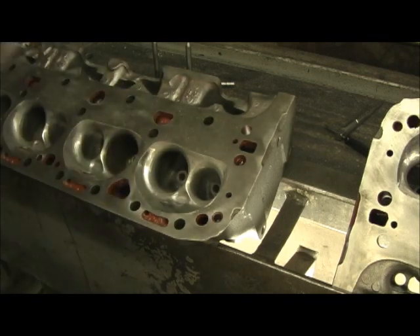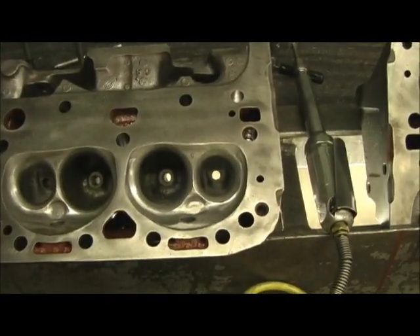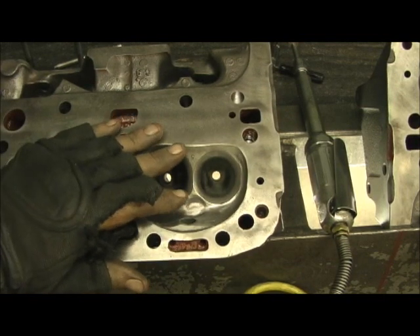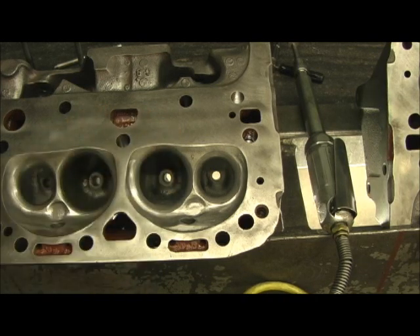The main reason that I do this is because of carbon buildup. When carbon sticks to the chamber and builds up, it will increase compression and raise the compression ratio. With 350 inches, he's going to be real close to detonation, so one thing we don't want is any increases in compression ratio due to carbon buildup.